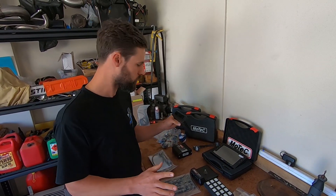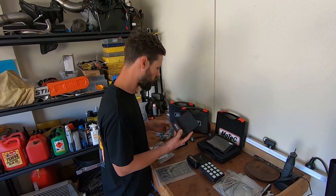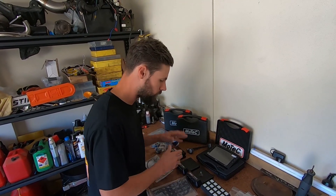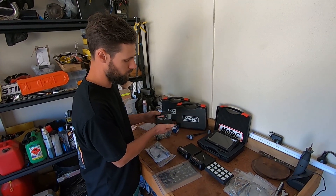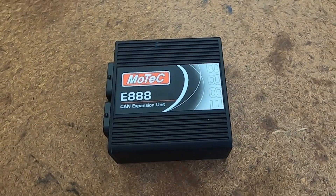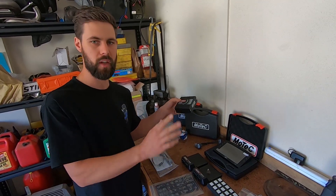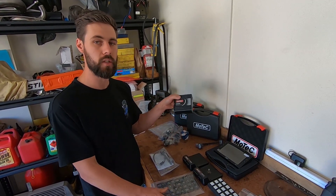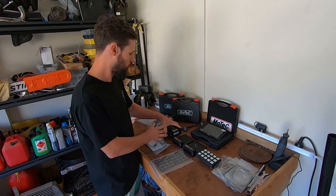It's going to have tons and tons of sensors, which he hasn't actually bought them all yet, so there'll be another swag of goodies coming at some point. Two connector, really nice ECU — it's got the nice M-Series fuel model that they invented when they wanted to bring out the ECU for the R35. This is the CAN expansion unit, which has a ton more IO on it that Matt can wire all these sensors to. Shannon can do engine protection and whatever other strategies he wants through the CAN. This one also does the EGT stuff and comes with eight EGT sensors.